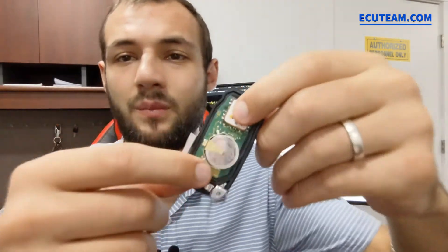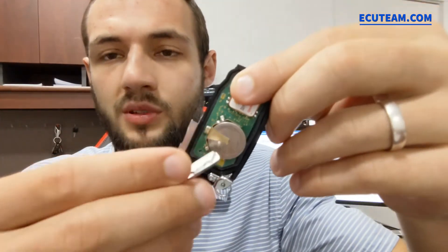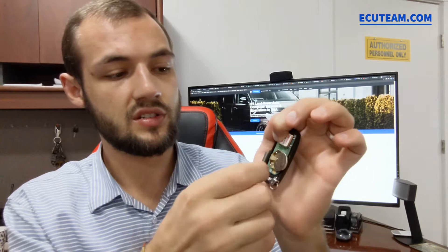This is another tricky thing. You won't be able to take the battery out that easily because this metal holder is holding this battery pretty hard. You have to be careful when you remove this battery. I take the service key once again — this battery has a couple of sides where the distance between the holder and the battery is slightly bigger, so there's enough space to fit the key in between. I try to place this key right here and move the battery to the front like that. This key just moves the battery out of the holder and you can remove it manually with ease.